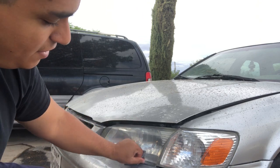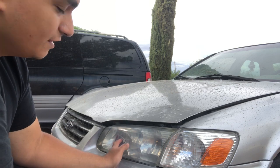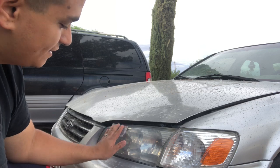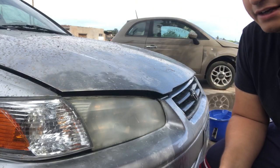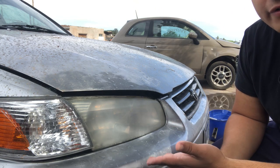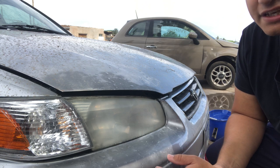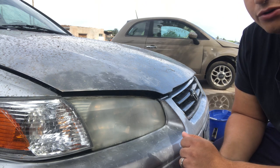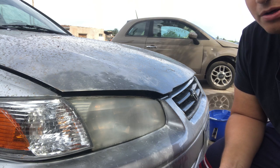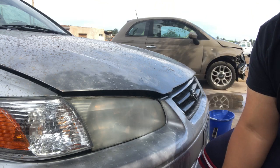I'm not a professional — I just like doing this, cleaning cars, pretty much mechanical with automotive. Now while we're waiting on the other side to dry, we already sanded this side down. As you can tell it looks really foggy and hazy, which is exactly what you want after you sand your headlights. The next thing we're going to do is polish up the headlights using the Meguiar's headlight cleaning kit.